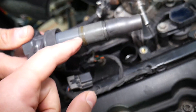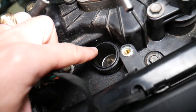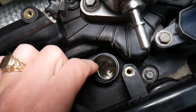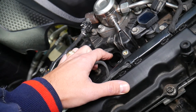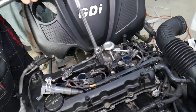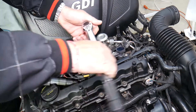When you pull your ignition coil out, inspect for oil leaks. We have just a little bit but not much. Right here between the valve cover and the cylinder head there are gaskets — that's part of the valve cover gasket. If you have quite a bit of engine oil in the spark plug well or hole, that means you have a failing gasket. You should not ignore that because it can cause misfires and make your engine unpredictable.